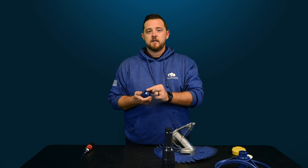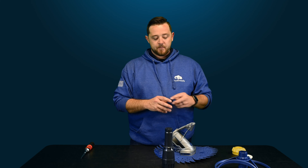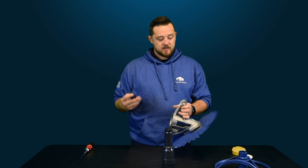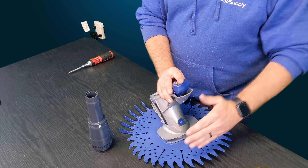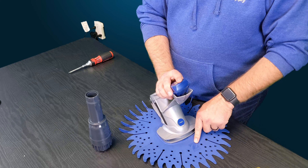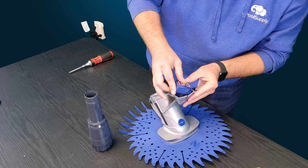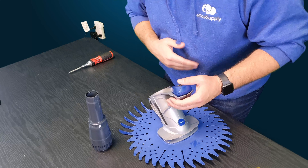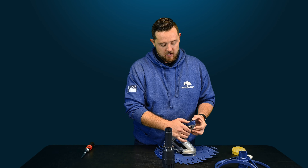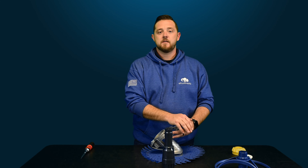It does have a little non-slip grip on one end, so when you install it you want to make sure it goes in the right way. It is directional — you want to make sure the logo faces the back side of the cleaner, so it actually goes in this way. This is actually the front. Once we get to the pleated seal I'll show you which way to orient that. To reinstall, just do it the same way you took it off — focus on getting one side in, and once you hear a click, the one side is in, then go ahead and push in the other side. Once you get that same clicking noise, your new float is installed.